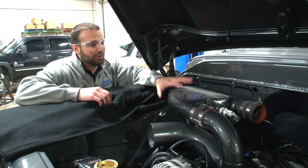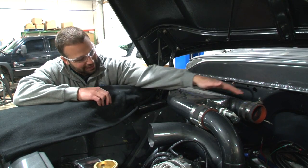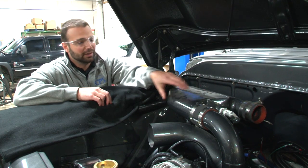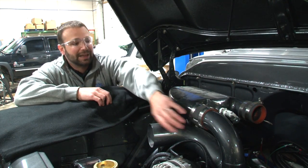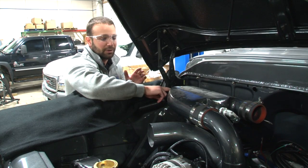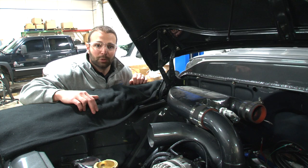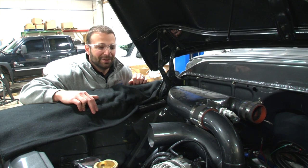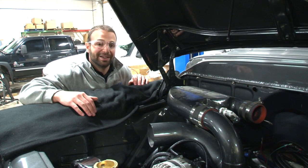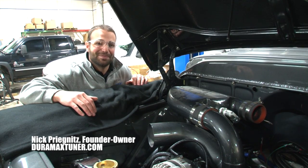Back topside, this is our Precision 1000-horsepower intercooler with a large air-to-water core. It takes the hot boost off the turbocharger, runs it through the core, cools it with the ice-cold water, and sends nice cool boost back into the engine. There's a one-inch fitting on each side for water in and water out, plus a boost tap to pick up boost pressure. It's a simple system but it's going to work really well. We've still got some wiring and other stuff to do, but we're getting our momentum back. I'm excited to have DJ cranking on this project — I'm Nick, thanks for watching.